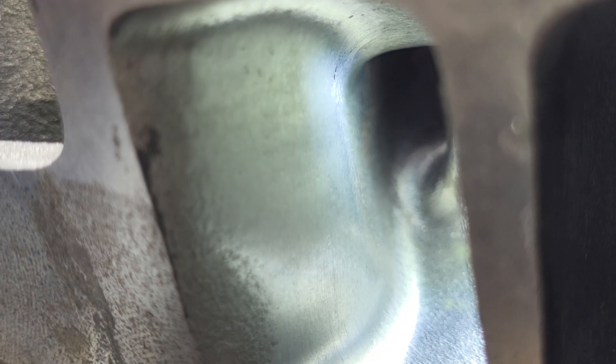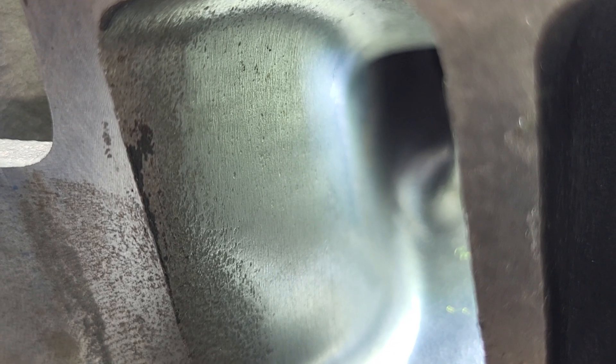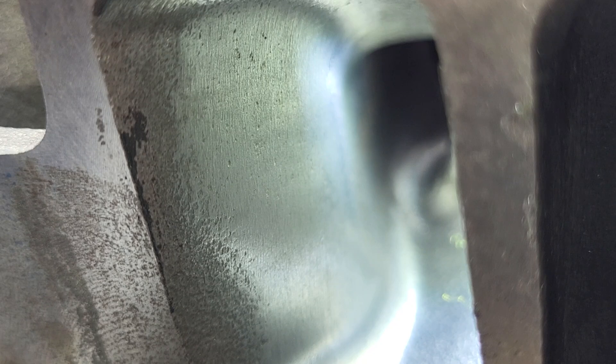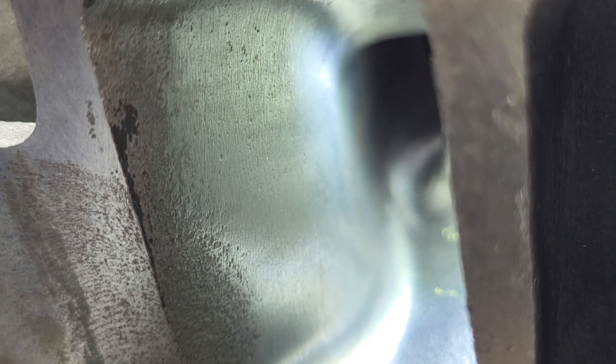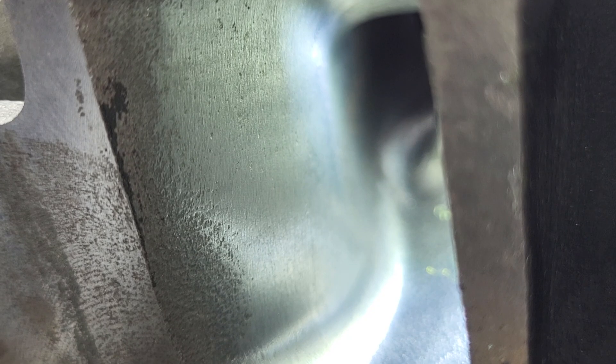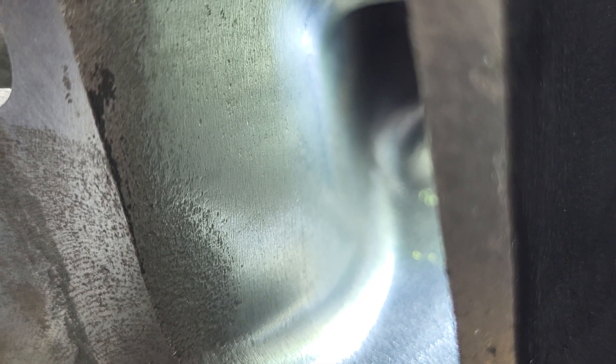I took the apex of that pinch and did a sand roll finish on it. The reason is our pinch is pretty small — about 1.9 square inches — so it should only flow about 277 CFM max at 100% efficiency on the bench at 28 inches.